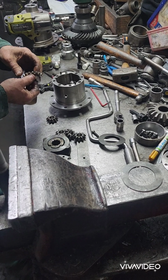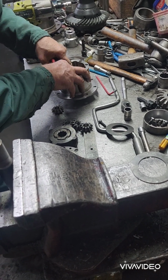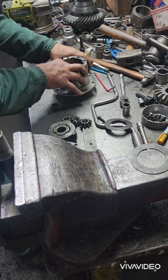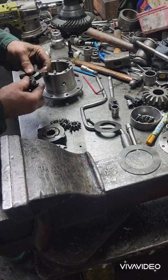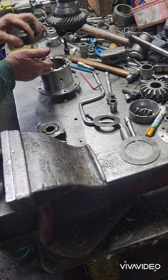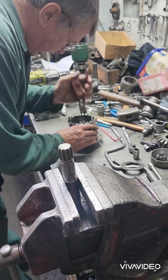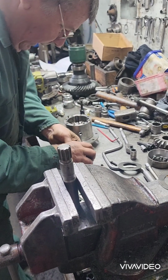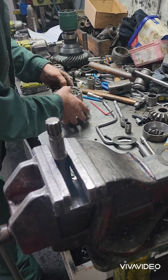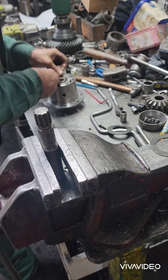So that's all right. Now the side gear goes in. There it is, it's fully down now. Now these, put the ears back on the little cross. And that one is facing upwards to where the mark is, you see. So there will be no mistake. Put it around the wrong way, it'll all lock up. Put that one in there. Now, that one, that one, that one.